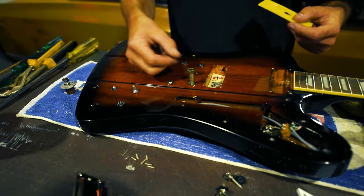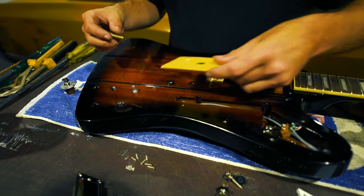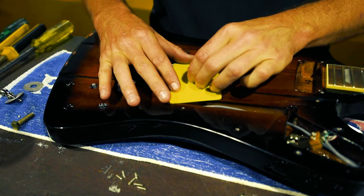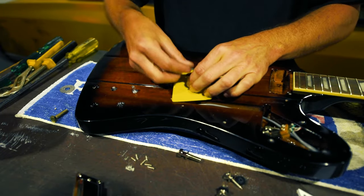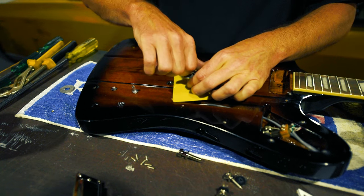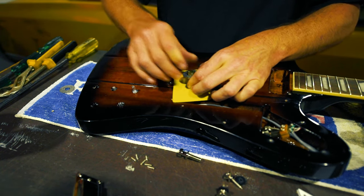Yeah, get in here and learn something. You want to pull these stud bushings out. Get something to protect the body, and then get a little bit of pipe wider than the stud, and you put a washer on it, and you can use the original stud or a bolt, I don't know, and you screw it in, and you tighten it up, and it pulls it out.